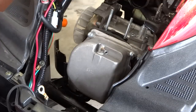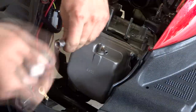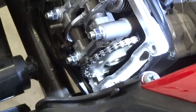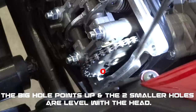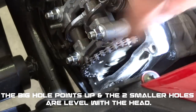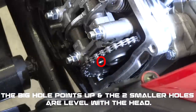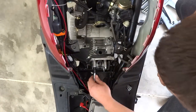It's time to remove the valve cover — we're going to take 5/16 bolts. We got four: one here, one here, one down here, and one on the side. Here's what top dead center looks like on the cam — you have a hole here and a hole right there, and they've got to be lined up flush with this piece. If you had a ruler, the two dots need to be lined up here and here — flush. Once that's done, you're on top dead center. Go ahead and loosen up the cam with a 10 millimeter wrench — break all four of those bolts.